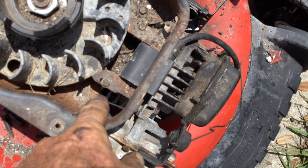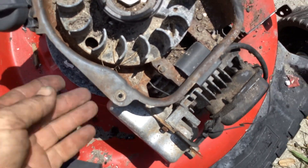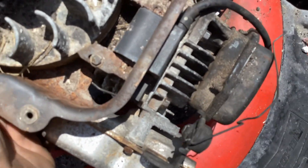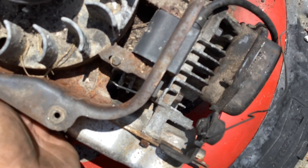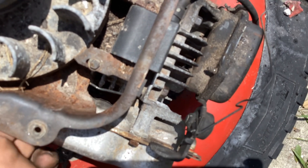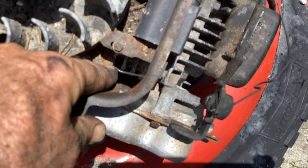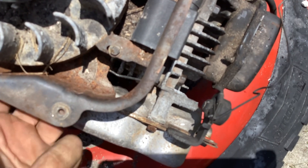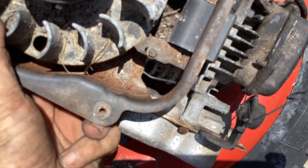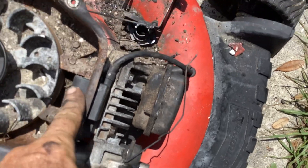The issue I would have if the wire was burned is that the wire could come in contact with the base of the recoil, and any little movement could possibly ground out the mower randomly. You can see it's kind of hitting metal here, but the plastic coating is still on it. If that were bare metal, any jumping around would intermittently ground out the coil.